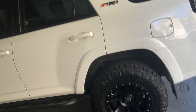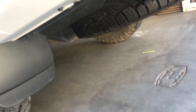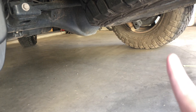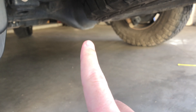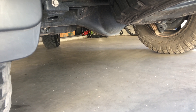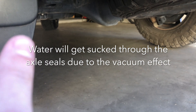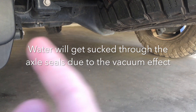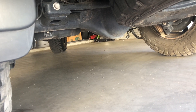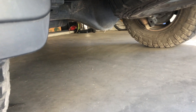It is four wheel drive, and the reason we're installing it is because when we go through puddles we don't want this differential to be submerged in water, because that'll essentially force water or oil out the seals on the axle. Then water will mix with the oil, and that's not a good thing — it'll screw up your rear diff.